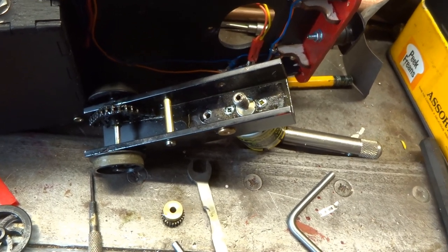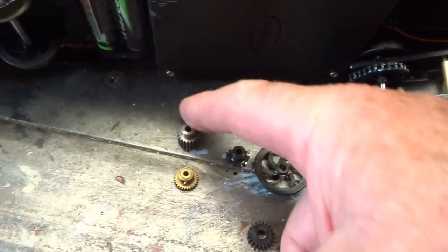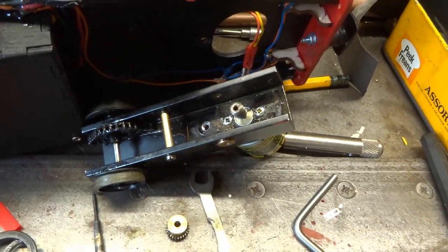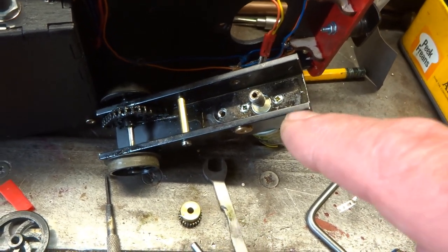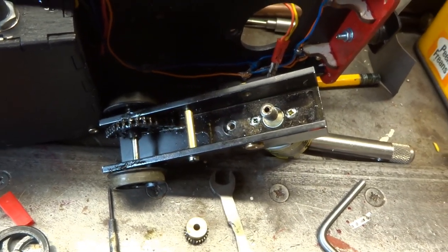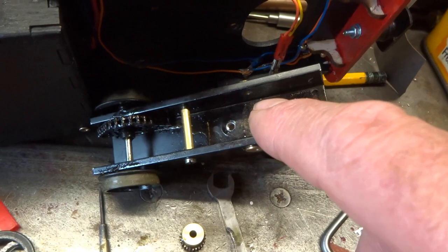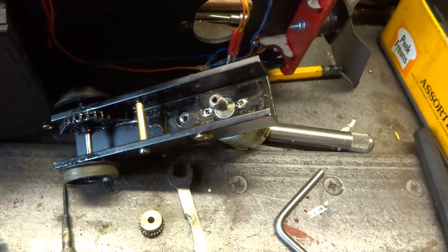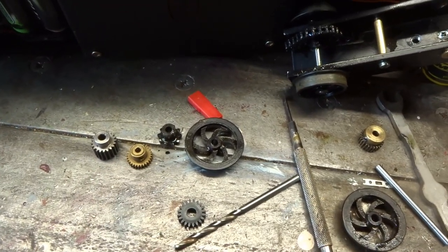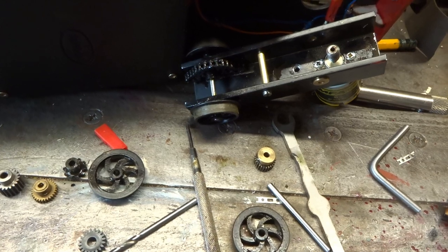So what I'm thinking, I've got various little brass gears and metal ones too, come to that, but what I'm thinking is it would be the easiest thing in the world to either make this steel on steel, or on the lathe, it's dead easy to make a worm drive on the lathe and turn a suitable worm up in brass or gunmetal on the lathe to drive a brass gear. So that's where I am at, but I haven't quite decided what to do.